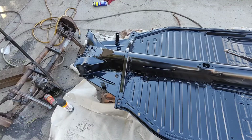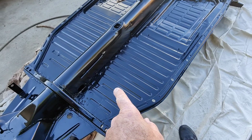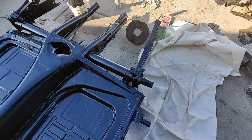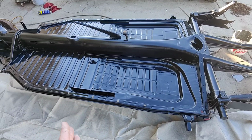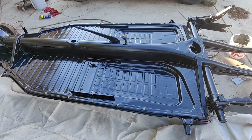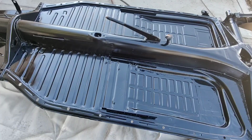It's nice and clean. The seams on this side, I did seam sealer on. This one, I'm going to do after, and then fill that in and fix that problem. That's why we're doing this, but get it to look good enough. It's just a lot easier to use a spray gun. I put a little thicker coat on there to be protected real well. That was sealer. The first thing you saw was epoxy primer sealer, and I just put that down and it went right over that while it's still sticky. You can do that with some products. You've got to read the labels to find out which one you can do it with. Some of the epoxies will allow you to go over it while it's still sticky. So I've got to let this thing sit overnight.